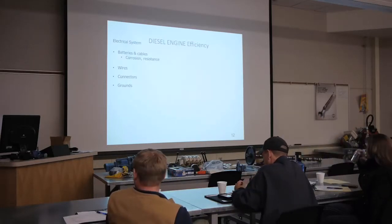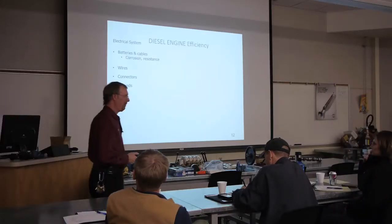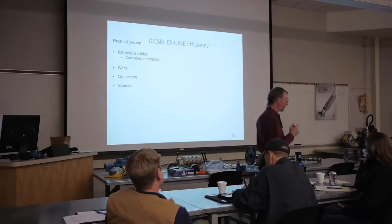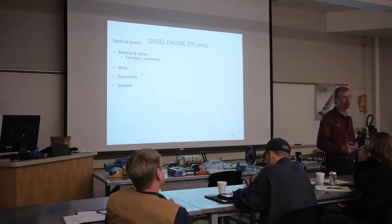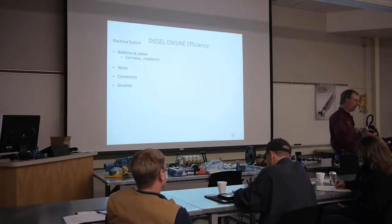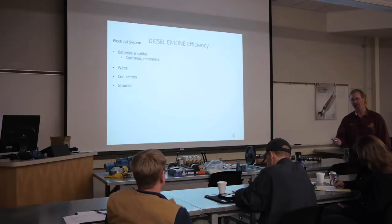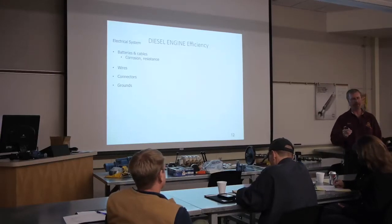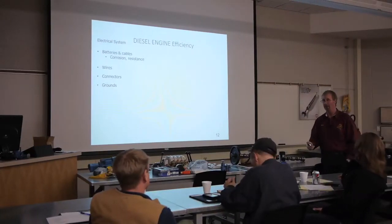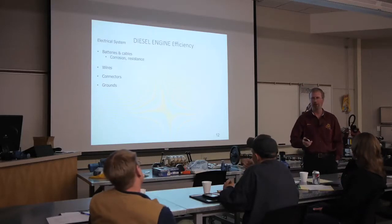Grounds. Oh boy, this can be the bane of existence. Typically, your grounds are not going to be for one individual circuit. They're going to be for multiple circuits. So if your customer, your producer, has multiple symptoms, then they need to get into a wiring diagram and figure out where the grounds are at. Might be corrosion, it might be that we got too many grounds on one teeny little bolt.